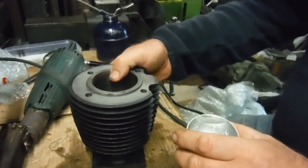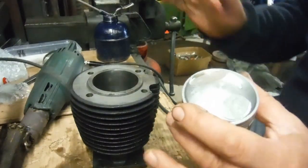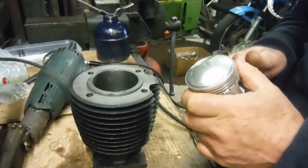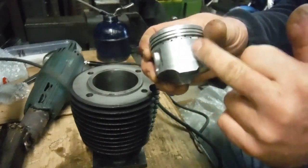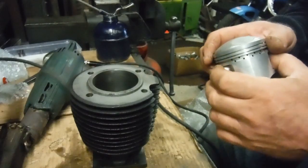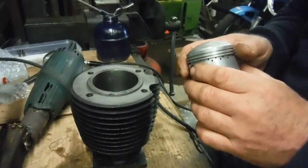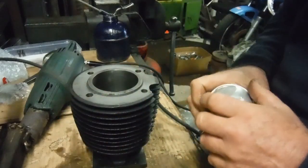But what I learned when I was working on an AJS 250 — a pre-war one, and admittedly that had a proper AJS pre-war 250 piston in it, so we might have to consider expansion rates — I found that machine had a tendency to try and tighten up, and did so a few times. I kept honing the bore, and where I'd get score marks on the piston I'd get a very fine flat file and ease those areas, and we ended up with an engine that ran very well when it was warm but starting up cold it sounded really clattery with a lot of piston slap.